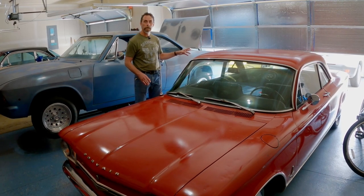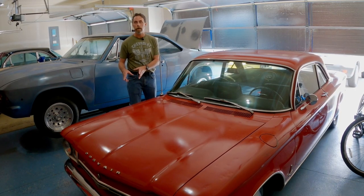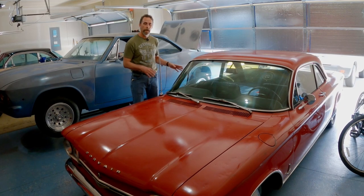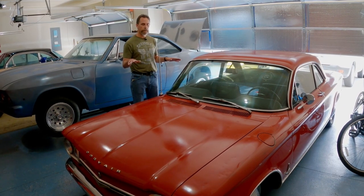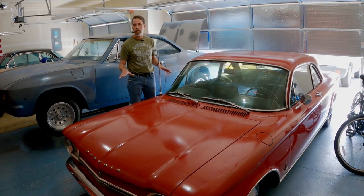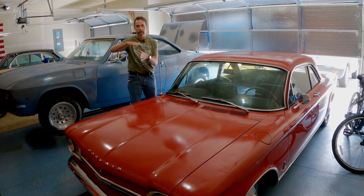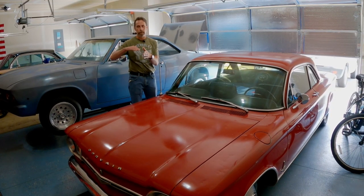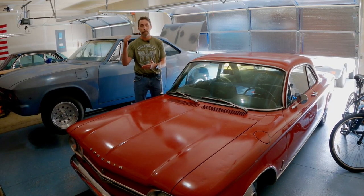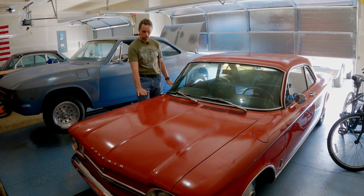Basically what I ended up doing was pulling one coil out of the rear of the car and two coils out of the front. I started with one coil in the front and one in the rear, but it was sagging in the back a little bit and didn't drop much in the front. The top of the last coil is kind of flattened to give you a nice seating in the saddle, so when you cut that first coil it doesn't give you a lot of drop. Once I cut the second coil, it dropped a ton — it's really low, way down on the ground.